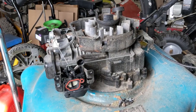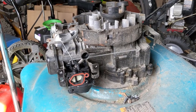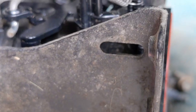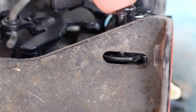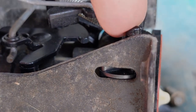I had posted that video last year in 2019, so fast forward to 2020 and Briggs and Stratton has actually fixed the issue. Coming down to the metal bracket here, you guys can see that they simply cut a slot into the metal plate which allows that plastic choke arm to go through and not get caught.